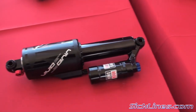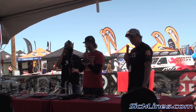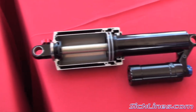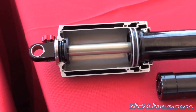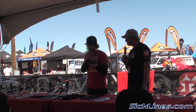We developed a brand new air spring technology called twin tube solo air. It doesn't ride on the air can like most solo air systems — it actually rides on a little inner sleeve on the inside of the air can. That allows us to reduce the overall diameter of the air shock but still keep enough residual volume at bottom out so you don't get a harsh ramp at the end. It maintains a very coil-like feel.